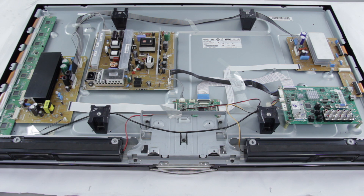Some common symptoms of a bad Y-Sustain: the TV shuts down and power cycles — your TV turns off, then turns back on again, then turns back off, running through a power cycle. If you have no picture on the screen, this could also be the Y-Sustain. Or if you have a dark picture on the screen, if you have a flashing screen with shadowy sections, this could be the Y-Sustain. If your TV makes a popping noise, which is usually quite loud, and then you have no picture on the screen, this could be caused from the Y-Sustain.